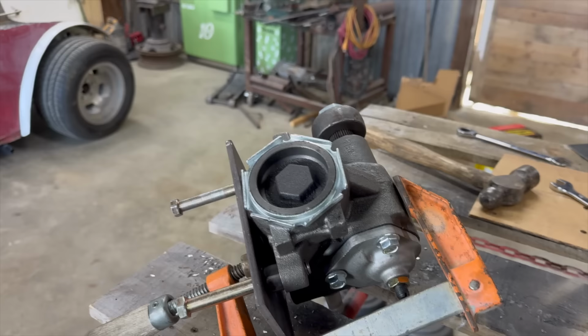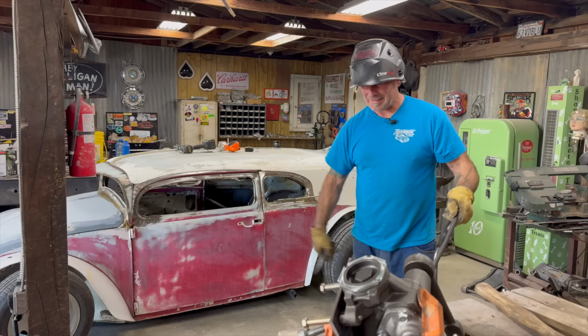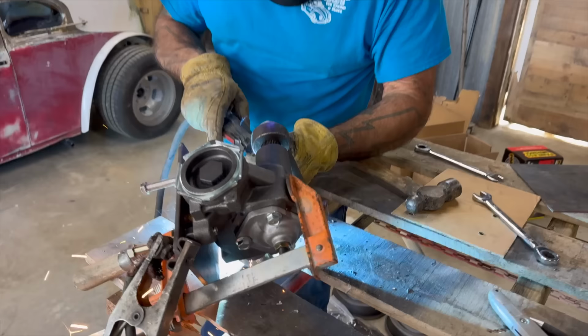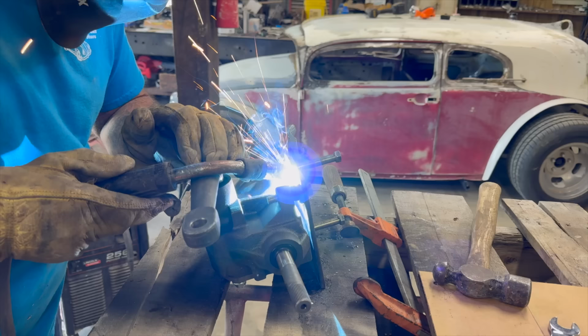Helmet. Yes, please. So we're going to want these welds to count. This is pretty thick steel. I am raising up that power. We're going to burn them hot without warping the plate. They're putting some nice tack welds in place. You don't want to heat up this plate and turn it into a potato chip shape. Again, distributing the heat without overheating anything. That's pretty close.